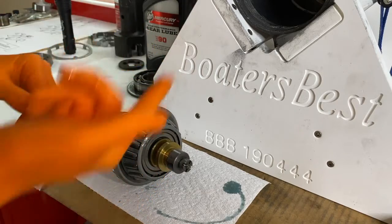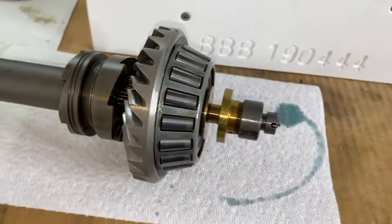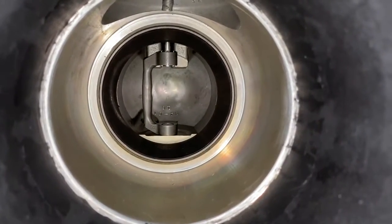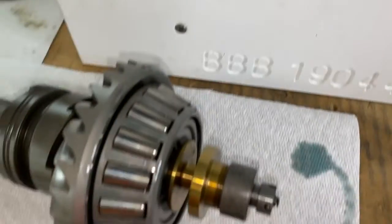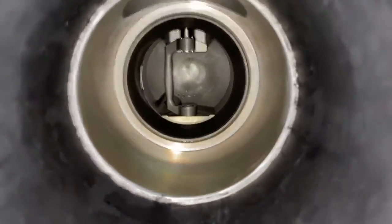Time to clean up and install this inside the lower unit. I would also advise lubricating the splines of the propeller shaft, however it looks like the shop did a very good job on that, so we're going to skip that. Coming inside now, to the rear portion of the inner case, that is your shift crank. You want to make sure it is shifted to the left, because as we lift up the propeller shaft and shift it into this lower case, this part needs to attach or lock onto that shift crank. The only way to do that, per the service manual, is having that shifted to the left.